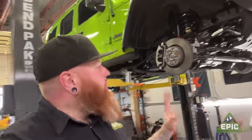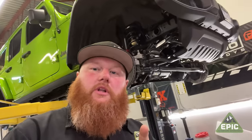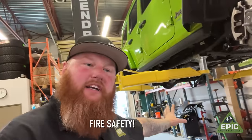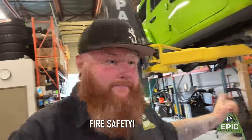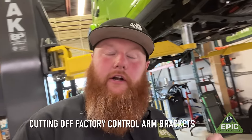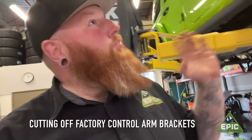First things first — this is a little different than a normal lift kit because there's a lot of prep involved. We have to support both axles, remove all the control arms, pull out the gas tank and set it safely aside so we don't start a fire — insurance companies hate that. Then we're probably going to remove a bunch of the exhaust. And then we get to the part where we start cutting off factory brackets and taking this brand new Jeep to an irreversible build.